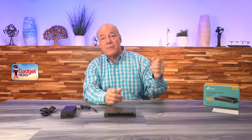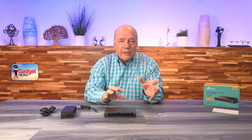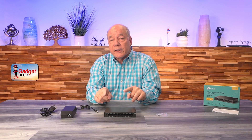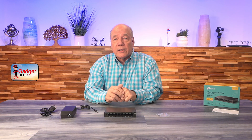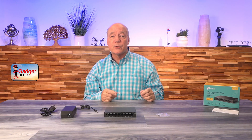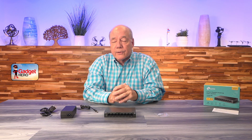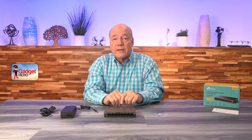It could be a security camera today, a smart speaker tomorrow — a lot of appliances and security devices nowadays need power over Ethernet, so having a switch that can deliver that is really important. There are also two other notable features. One is auto recovery: if you have trouble with a peripheral, the switch will reset the PoE connection and deliver power so the device can reset itself. The other is an extension mode for ports one and two, where if you need extra power for those ports because the device is quite a distance away, you can flip a switch to deliver that extra power.